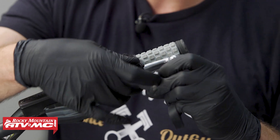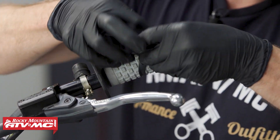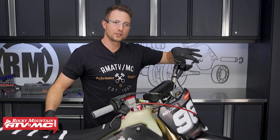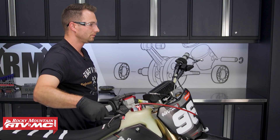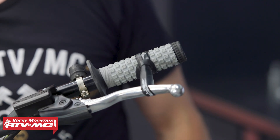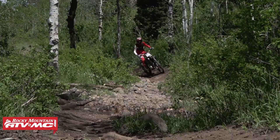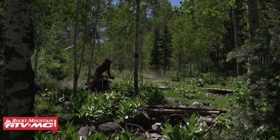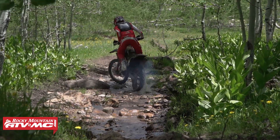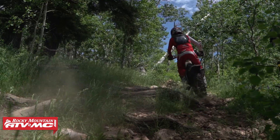Now that we've made our adjustment, we'll take this strap off, get that out of the way, and reinstall this rubber band. Start the bike up and recheck our free play gain. Once you have your free play gain set, you're ready to go ride — but I can't stress this part enough: you need to follow the break-in procedure outlined in the manual that came with this kit. If you need this kit, it's available on our website along with just about anything you could want for your bike. We offer free shipping on orders over $75, and for more helpful content, subscribe to our YouTube channel. Thanks for watching.